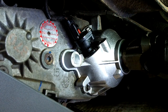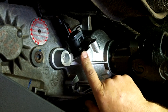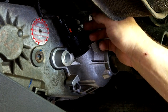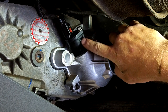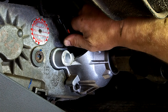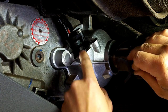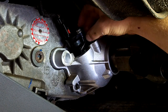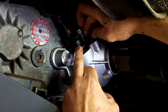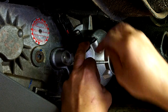Push it in like that. We've got a 36 in there right now, so that would be between the 32 and 38. There's a little notch right there pointing to that. That's where, when you put this item back on here, you're going to rotate it right there, which lines up with that bolt hole.